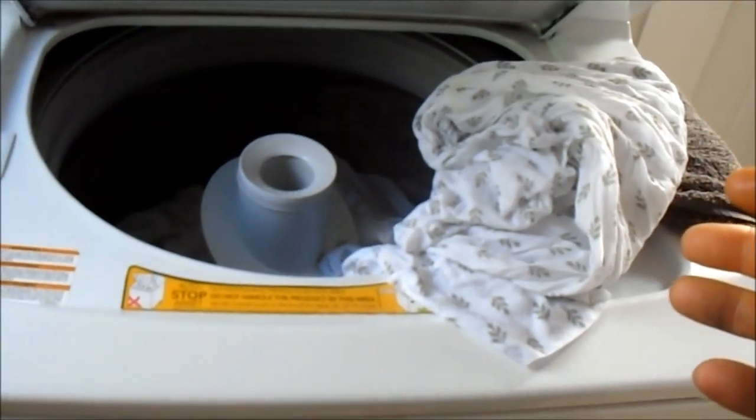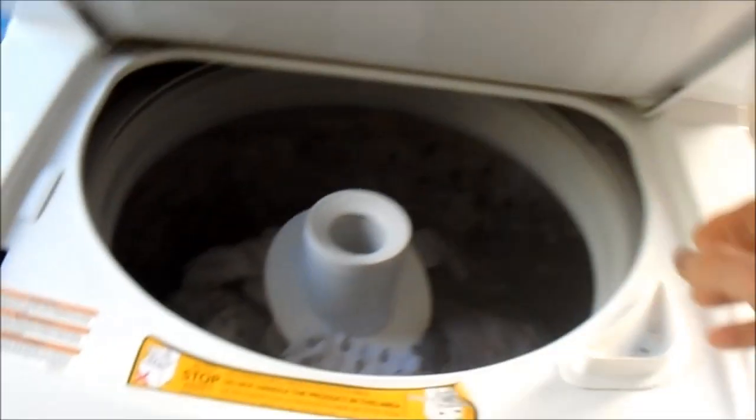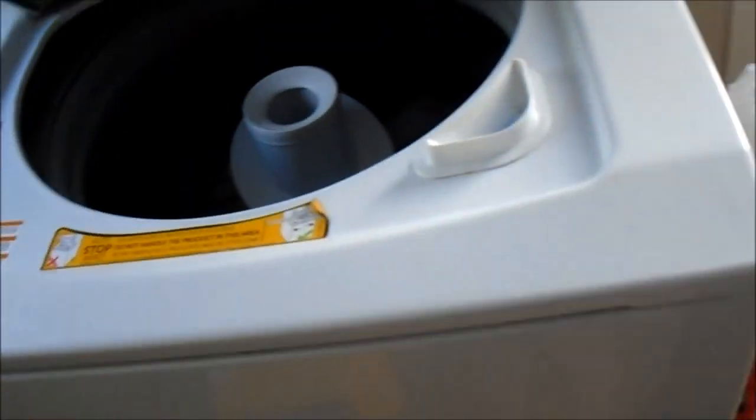These are house cleaners, right? They're not washing machine people. They're like, let's do the laundry — cram it full. I've been there, man. Put as much stuff as you can in there. Yeah, that big quilt was in there too. That's the problem with this thing — it got overloaded. All I had to do is do the hard reboot. Of course, I'm going to fix that drain vent that's bent too. Okay, that solved the problem. I was lucky.